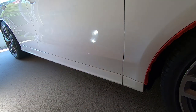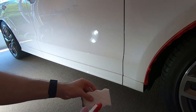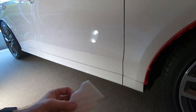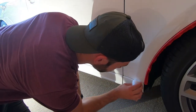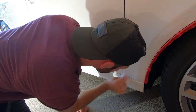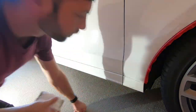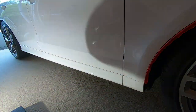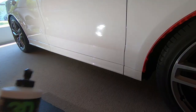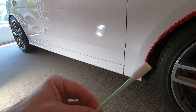Here in between the doors and the rocker panel there is this brown kind of line. I'm not sure what it is but you can't just wash it off — it doesn't come off easily. I was having a hard time polishing it off, so what I'm going to do is actually use a magic eraser. A magic eraser is basically just 3,000 grit sandpaper, so it's going to dull the paint here, and afterwards you're definitely going to have to compound or at least polish to bring that shine back. You also want to be careful not to rub too hard, too fast, and for too long because you can burn the paint. So I'm simply taking a brand new magic eraser using ONR to give it some lubrication — it's almost like wet sanding.